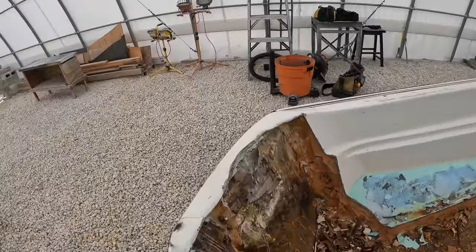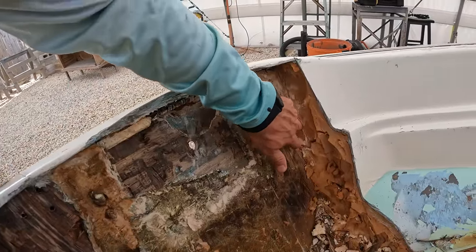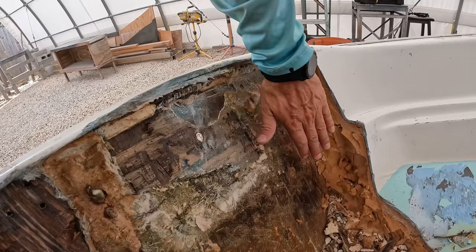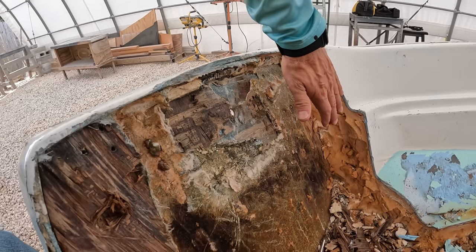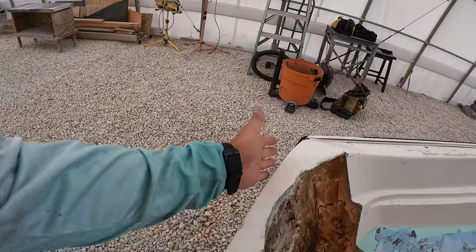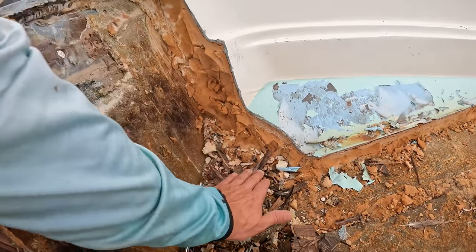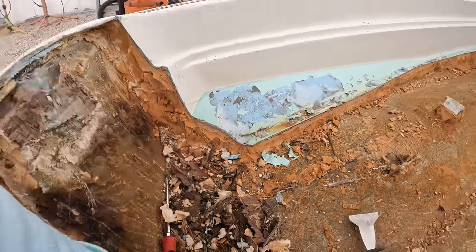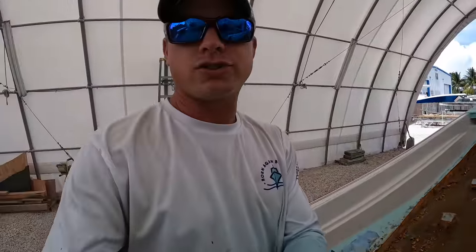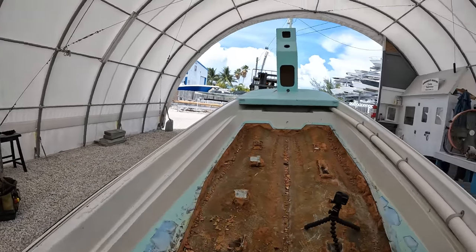We're going to lay our glass down. I got to cut all this foam back so that we can lay our glass down and around and wrap it like that into the transom, so that it seals it there. We're going to take glass and wrap it over the top of here, smooth all that out on the back, and then also wrap our glass down around the bottom, so that it's completely into the boat. The transom will be one solid piece on the whole boat, and that way we'll get some longevity out of it.